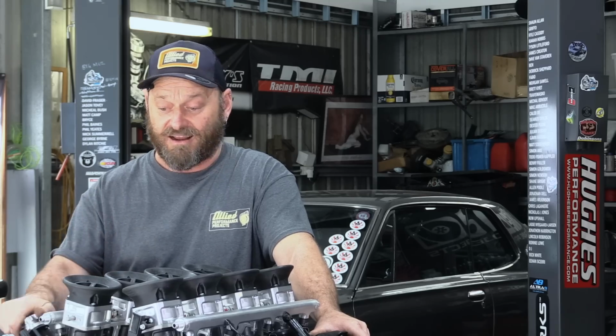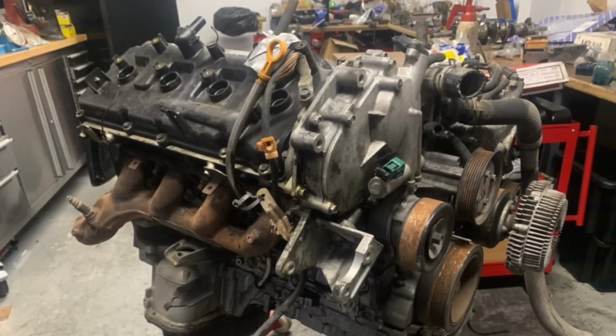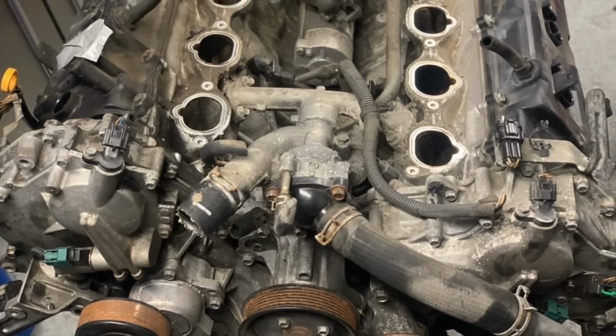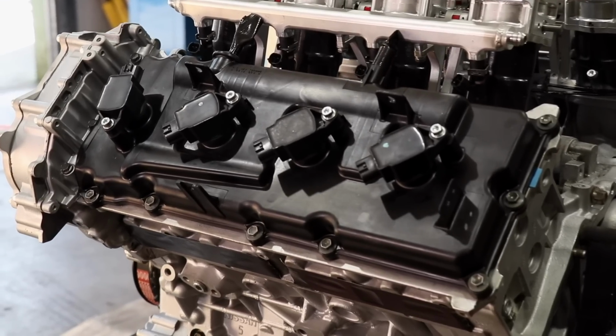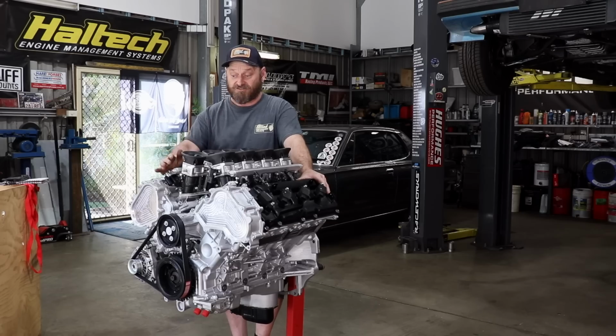The engine started out as, I think it was about 2008, Nissan Titan VK56DE, so it's basically a truck engine in the States. We did get the VK56 later on in about 2014 or something in the Y62 Patrol, but it's a fair bit different to this. They continue to develop them with a lot more valve train technology and that sort of thing. But this is a fairly simple one as far as they go.